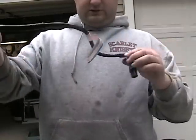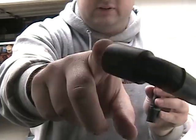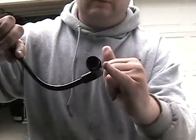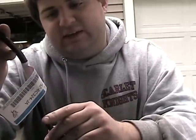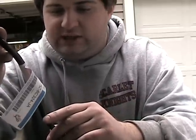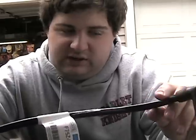This is what the tube looks like. Basically it sits like this in the engine bay — this little elbow goes on the back of the intake manifold, and this PCV valve goes inside of the passenger side valve cover. It's Ford part number F75E-6C324-JB. I bought this on eBay for about $33 shipped, not too bad. It was here in about two days. I'll see if I can put the seller's information in the description so you guys can find one if you need it — he had a few of them.